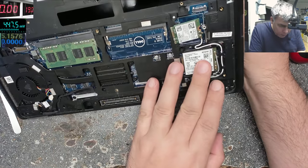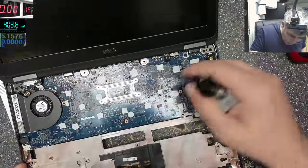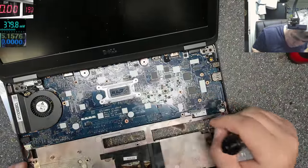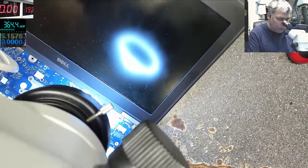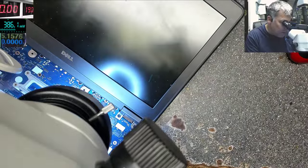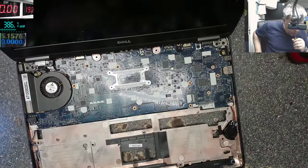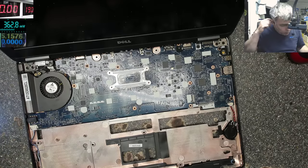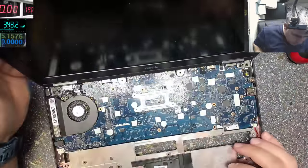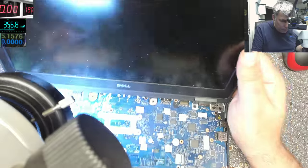So we have the 3G card. Yeah, the Wi-Fi card. Oh no, we have the hard drive. Okay, it's a normal hard drive. But this can be a solid state hard drive. Let me check. Synaptics, no, it's not. Okay, so what do we know? We know if we plug the charger, something is shorted. And what do we have here?